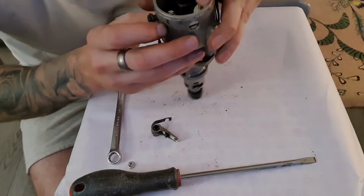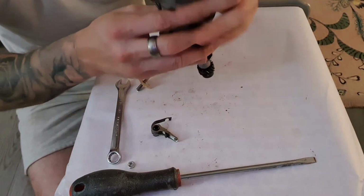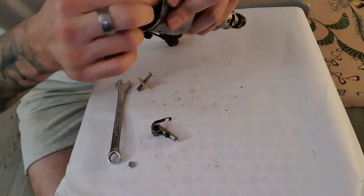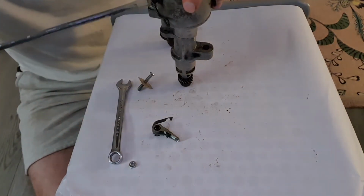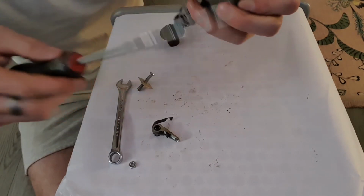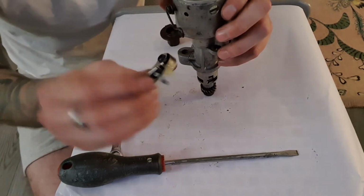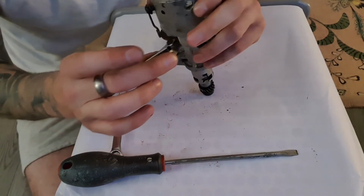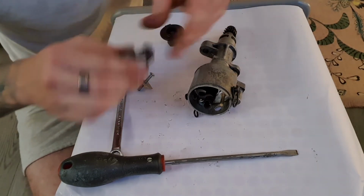The remaining hole there is actually for the screw that holds the condenser in. Now I've left the condenser in the garage right now, so I'm not going to actually fit it. This plate's gone in slightly crooked, so let's just straighten that up. That hole is there now, so it's all good. So what we've got is our points here. Really could do with replacing this one. It's slightly bent on the spring. Just give that a little bit of a tweak there.